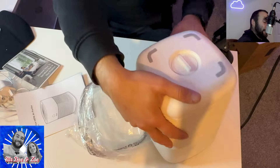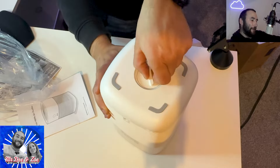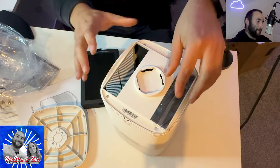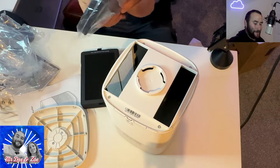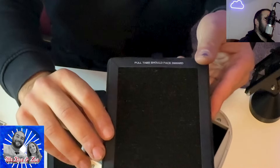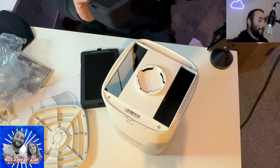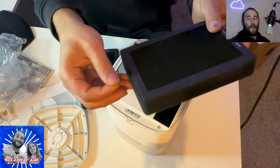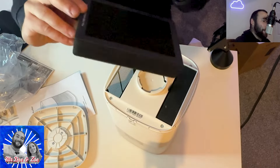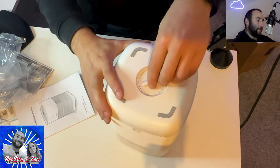To access the air filters, you have this secure lock under it. You just turn it and you pull the filters out. As you see it says pull tabs inwards, facing the fan. It has two useful tabs that you can use to pull your filters out. So you put them facing inwards like that, and then you close the box like this.